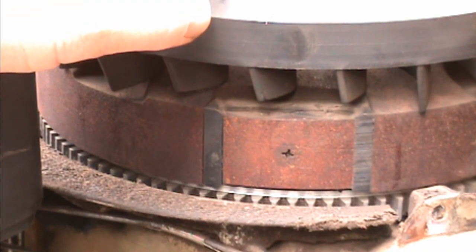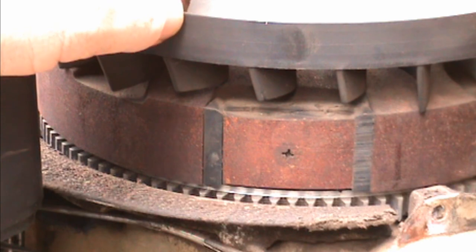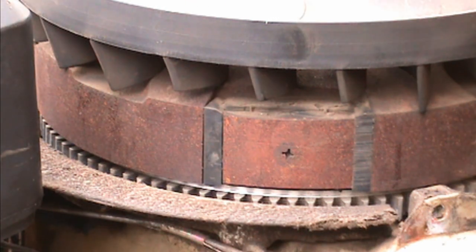The problem is when you do that spark check, you see the spark but you're getting a false spark. It's just enough contact between them, but it's not really contacted properly. The width between the armature and the magnets is about the thickness of a regular business card. What happens is it causes just enough current to give you spark, but it is not really strong enough to do the job inside the engine.